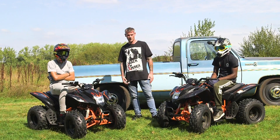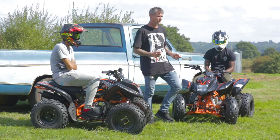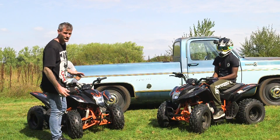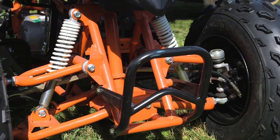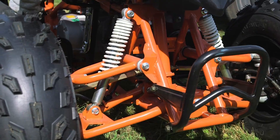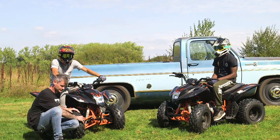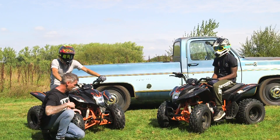Let's start with a few of the features of the quad bike. When we designed this bike, we started off with one of the most important features, and that is independent front suspension — not only independent, but double wishbone front suspension. We have two wishbones. What that does is it allows the wheel to travel up straight when you're cornering hard and also when you're going over bumps, making the quad far more stable and less likely to tip over.